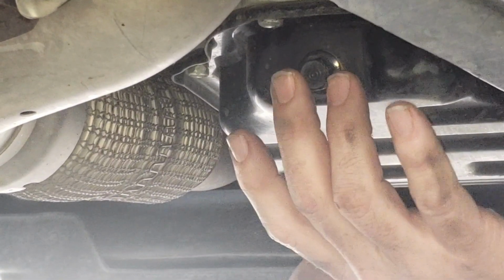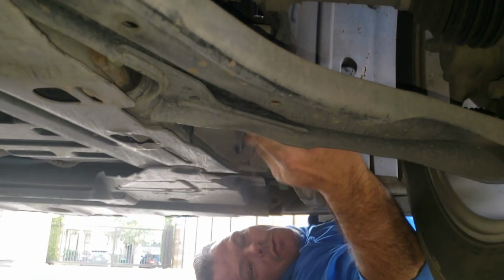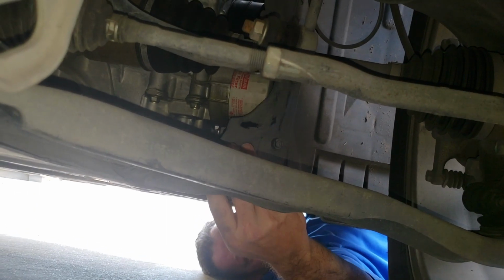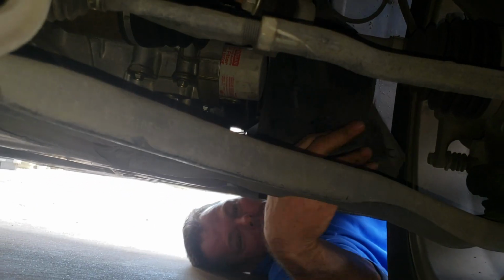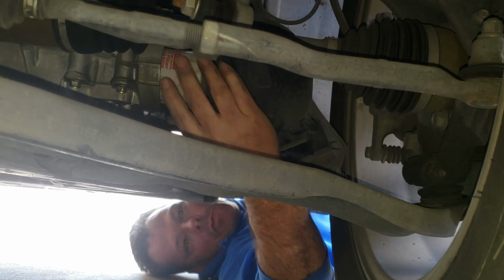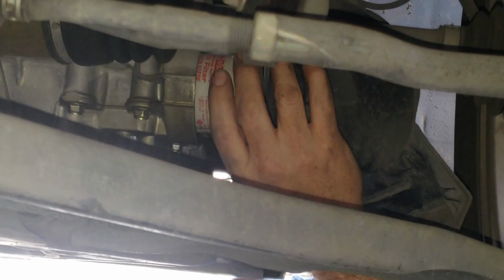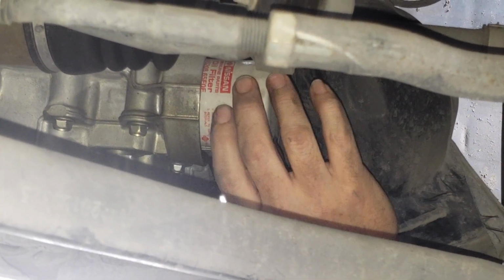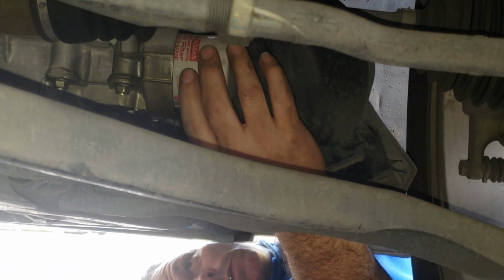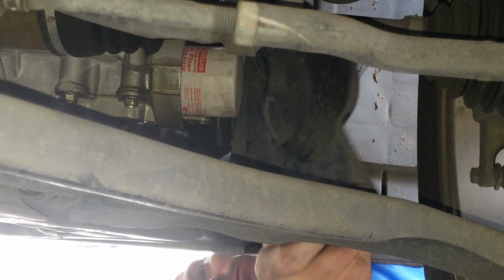And then as soon as that's drained, I'm going to come over here, and there's a plastic cover that is behind this, right in front of this shaft. You could take that off. I found out you can just kind of tuck it back behind the brake caliper or something, and grab the oil filter, which is right here. And so I'll come over and take that off, drain that out as well. So I'm not sure how much of this we'll be able to shoot with the drain pan under here going to block the view, but we'll try.